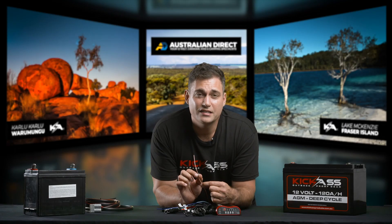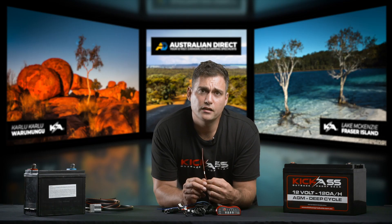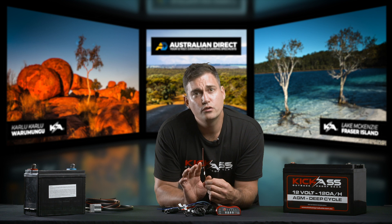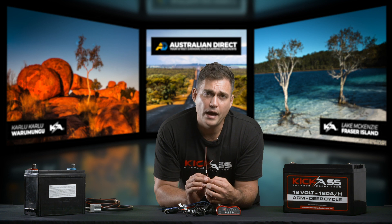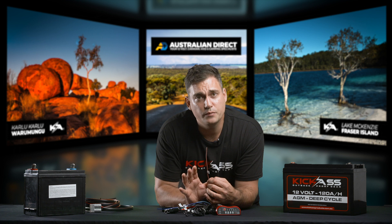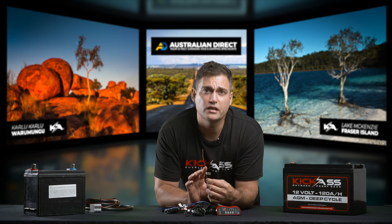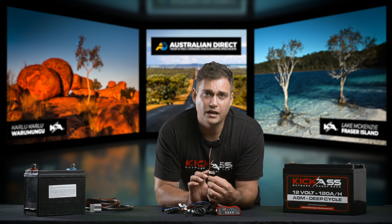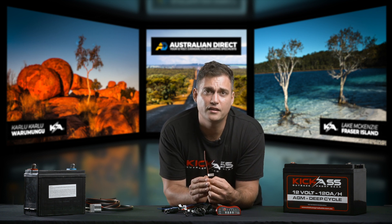The last little wire here is an external LED. If you've got the DC charger mounted in a position that you can't see its display, you can run this cable to a 12 volt LED light — any kind of low power 12 volt LED light will be fine. When the DC charger is in charging mode, the light will flash and you can run that to a light in the dash or anywhere else you want it to be. Just remember it needs to be a low powered 12 volt LED. This is the positive wire, so you'll have to run the negative wire of that light to a ground source such as the vehicle chassis.